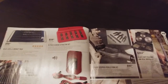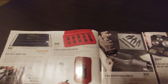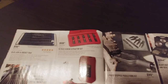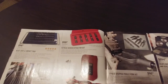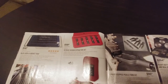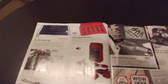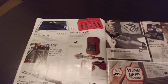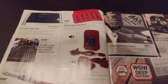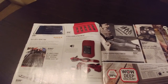Looking at the extractors — I've never had much luck with that style. If you strip out an Allen key or a triple square, most of the time I just drill it out, then helicoil it if I have to. Usually once I drill the head off, I'm able to back the nut out by hand — you just have to take that tension off. A lot of our stuff is seized in pretty heavy, so you're not getting it out with an extractor. Most of the time it's because you didn't clean out the tool and kind of half-assed it in.